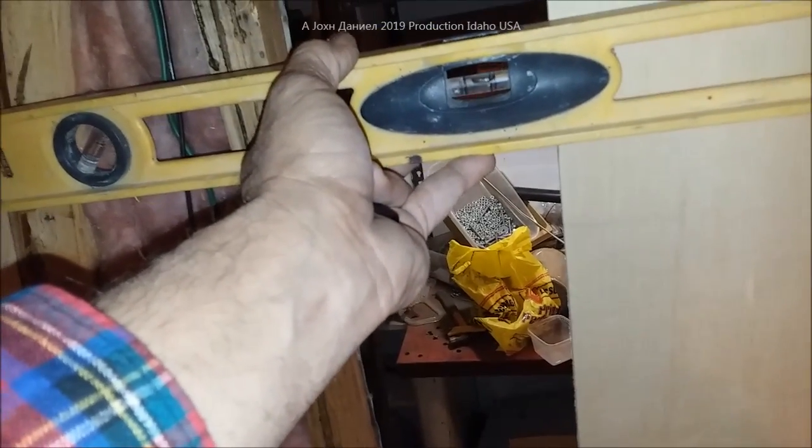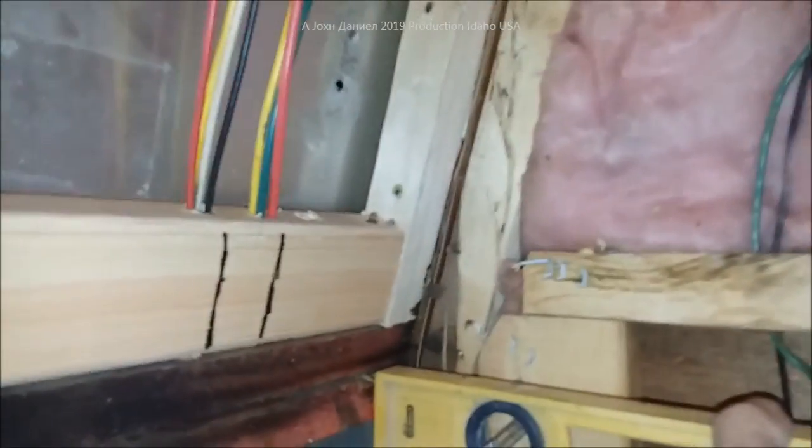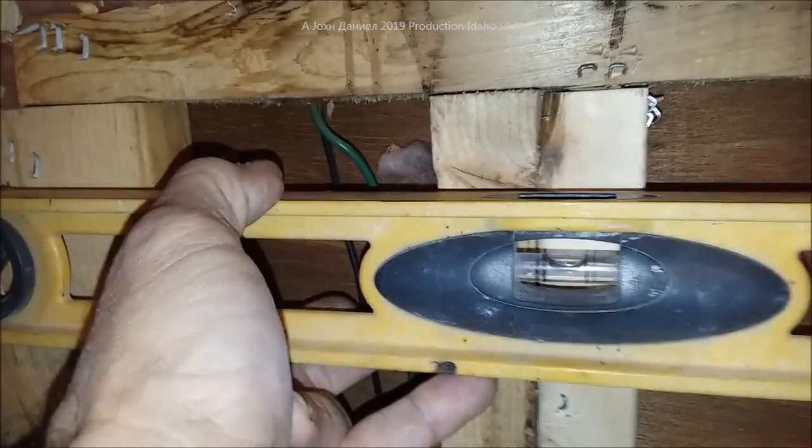And the way that it works is you're going to use the corner of the level. Now I've leveled this board out, leveled the trailer out so that we're all equal here. And using the level, I will set it up and get it level, and I draw a line. So you'll have a line going right there. Now, as my distance increases for my cut or decreases over here, I've drawn a little bit longer line, as you can see there. And then down there to the center point, which is this little sharp point up in the front, you can see that that's a level spot also.